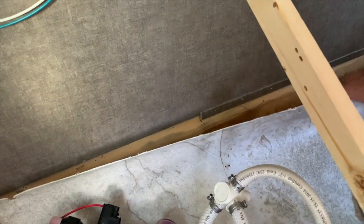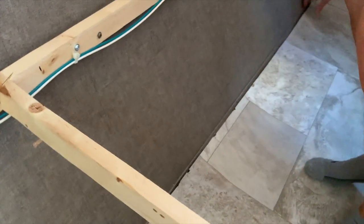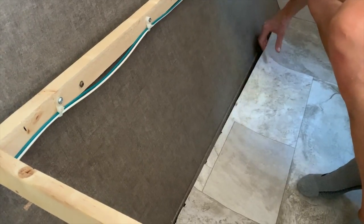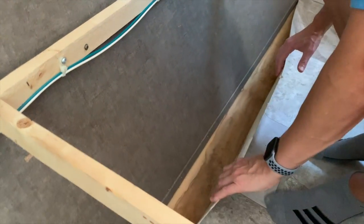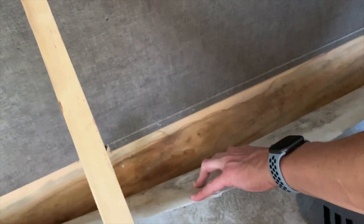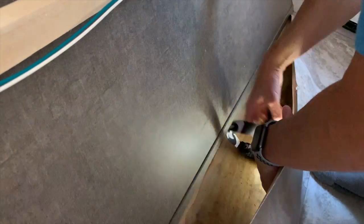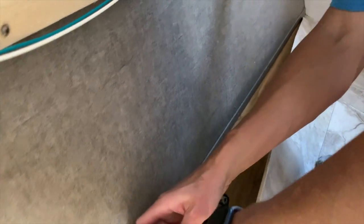This was a bit of a mystery. It appeared that the floor had already been cut in this area and this would have had to happen before I took delivery of the trailer back in April 2017. Unfortunately, as I peeled back the floor, there were obvious signs of water intrusion. This was a very disappointing discovery. Using a headlight, I determined that not all of the floor was stained from the water and there was about a 6-inch wide strip of wood stain near the wall. We simply couldn't see the extent of the damage with the vinyl floor still attached.